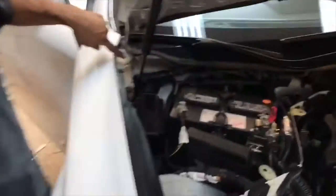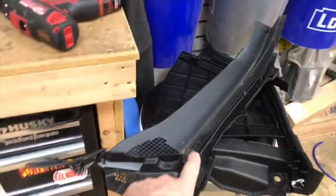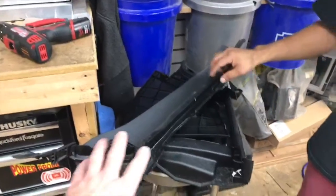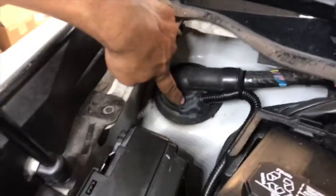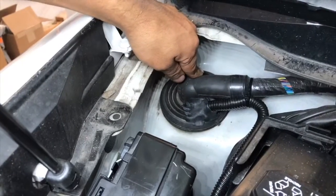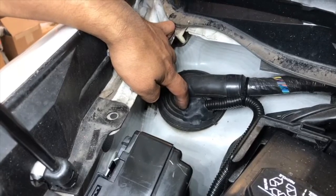It's actually a really super convenient and almost silly spot. Forget going over there, come over here. There are a couple of pieces of plastic you have to remove: the shield that goes up next to the window, and of course the battery cover. But they're just clips, so they pop right off. It's pretty simple. Now, see where we have our cool strip caulk goo? Right there is the grommet that goes directly into the passenger footwell of the car. I mean directly. It's a straight shot down.